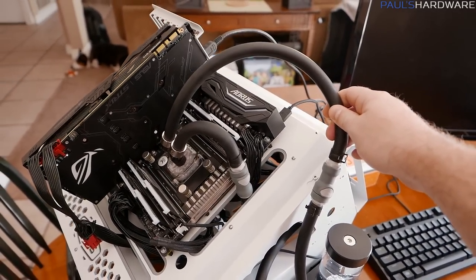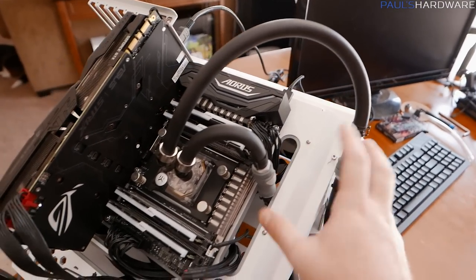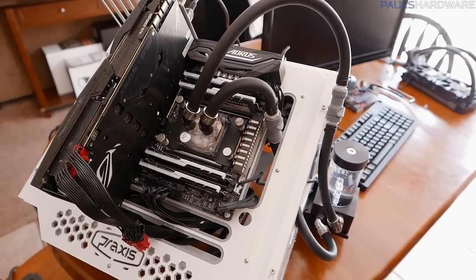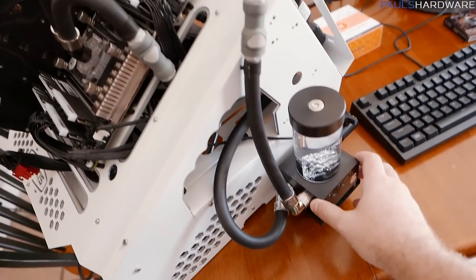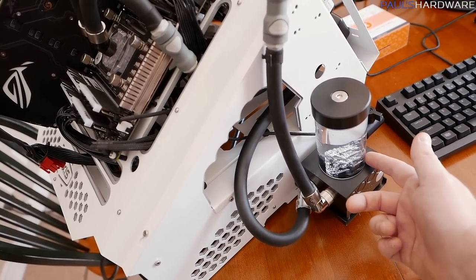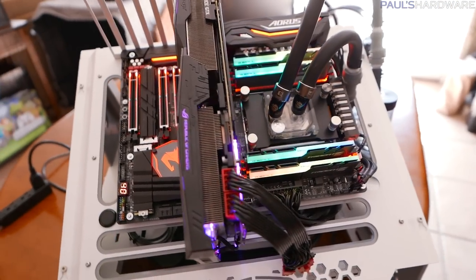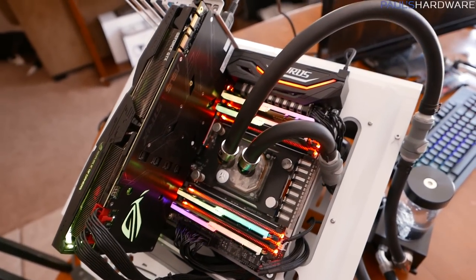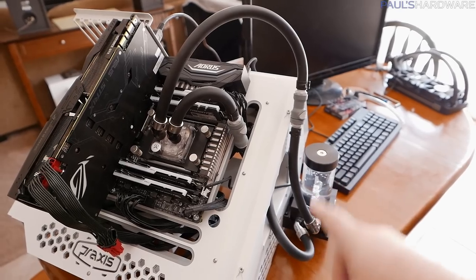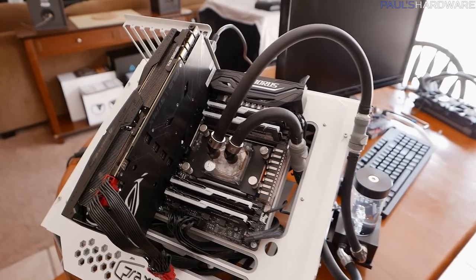I have lots of PETG hardline tubing but not a lot of flexible stuff, so this is nice because it allowed me to use the quick releases still — meaning I could pop this off and pop on a different block if I swapped out the motherboard to X299 or something. For the actual pump and reservoir, I used the same existing pump and res salvaged from Arctic Panther, which was still in fine shape. After getting everything installed and the fittings in place, I had to cycle through a bunch of cleaning since some equipment has been used before, refilling the reservoir with distilled water multiple times and cycling it through to make sure everything is clean.